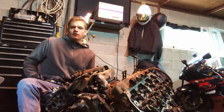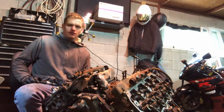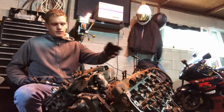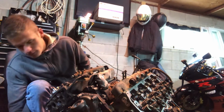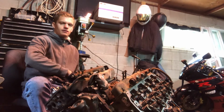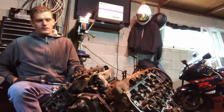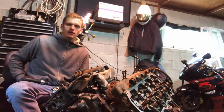Also, the exhaust, either 4-inch or 5-inch straight pipe FlowPro exhaust or MBRP exhaust. It doesn't last as long. It kind of gets rusty faster, the metal. And the same thing as the upper vents that are coming out of the valve covers here, those can also be vented. Down here at the front of the engine cover, there's also a vent, and you can also run that pipe up with these other pipes and just out to the side of the engine, so it's breathing and venting out properly. That's another thing with diesel engines why head gaskets could go bad, from not having proper ventilation inside of the engine.